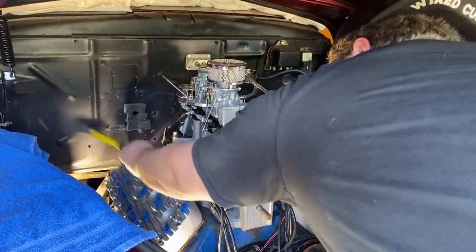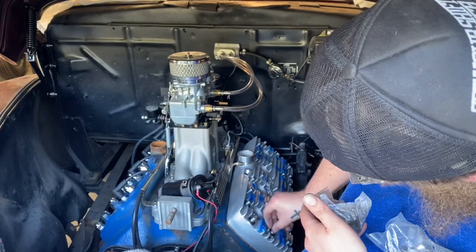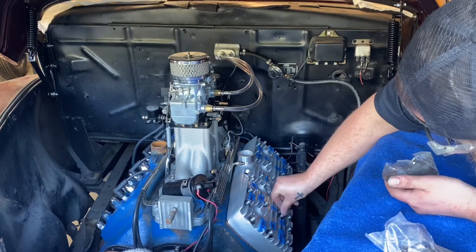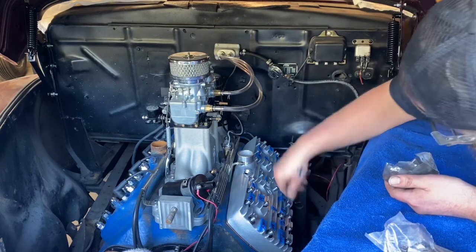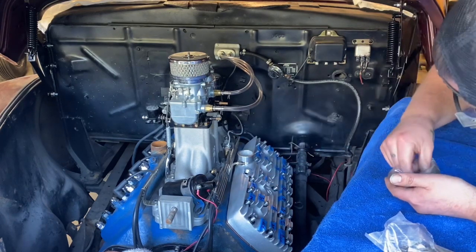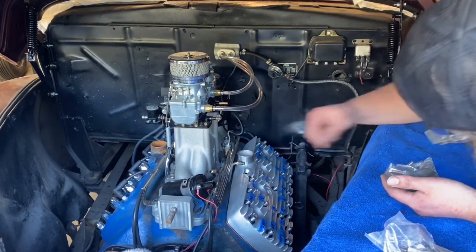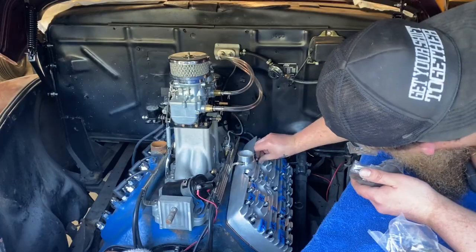I can take a few love taps to make sure the head goes on nice and flat. What I failed to record: make sure you spray both sides of the copper gasket heavy with copper spray — this is super common on head gaskets across many years of vehicles. Stick it on over the studs. Also, on the aluminum head I put anti-seize with my finger inside where the studs go through the head. I don't put anti-seize on the studs themselves because I'm afraid the compound might spread over to the head gasket area. Head gaskets on flatheads almost have to be perfect to seal, so be very careful. Sometimes the heads require just a little rubber mallet to sit completely flush and flat against the block.